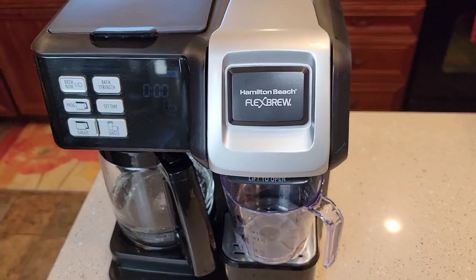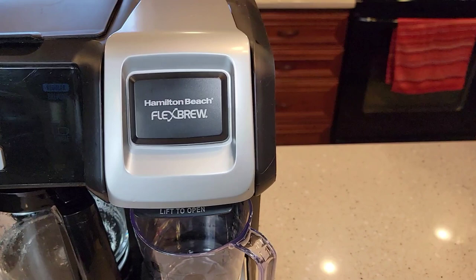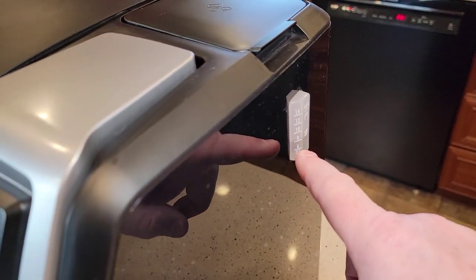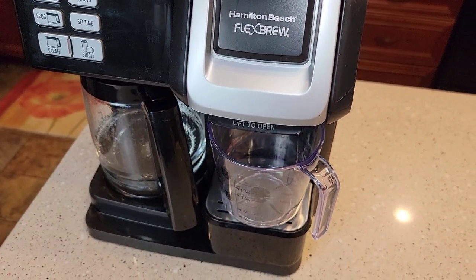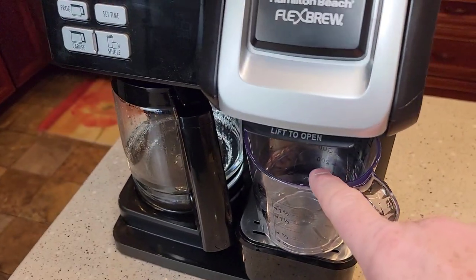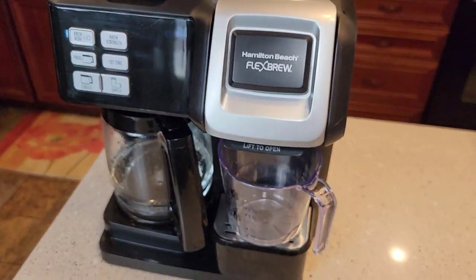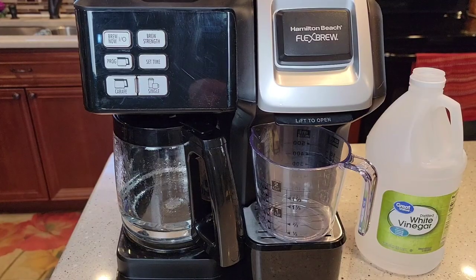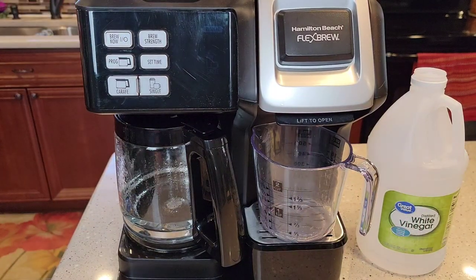You've got to be pretty quick with this. We're going to start — it's brewing on the single serve side. What's going to happen is that vinegar is going to get heated up first, and after it's heated up, it's going to shoot it out with a pump. That's when we want to stop it. We're going to let it heat up, and then as soon as you get water coming out, you're going to hit the stop button — just turn the coffee maker off. This takes less than a minute to heat that vinegar up. The vinegar is brewing, it's starting to come out — we're just going to turn it off.